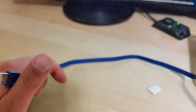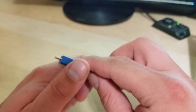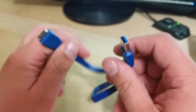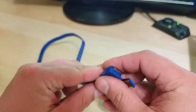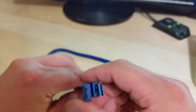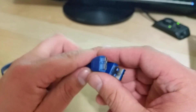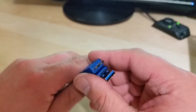An alternative way to find out if it's real USB 3.0 would be to connect one part to your USB 3.0-supported device and the other to your USB port on your computer, which would also be blue. If you get a message on your computer stating that your device can perform faster, then chances are your cable is fake, or you don't have a USB 3.0-compatible port. But usually if it says your phone can perform faster, the cable is probably fake.